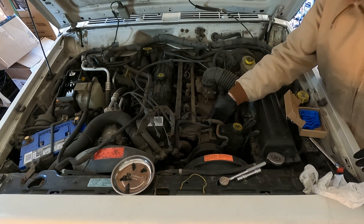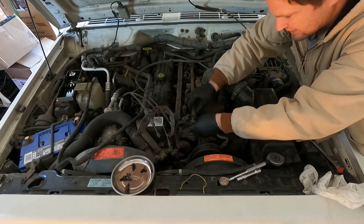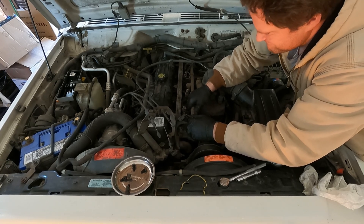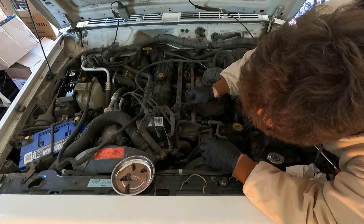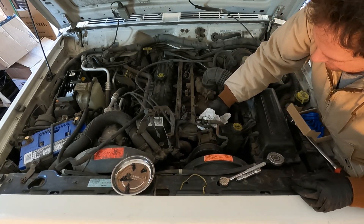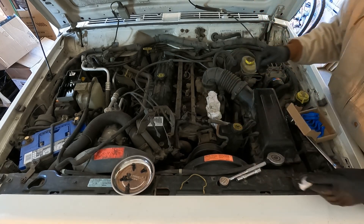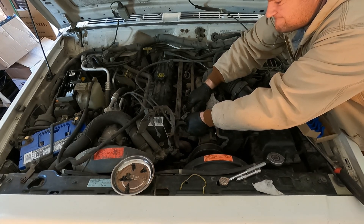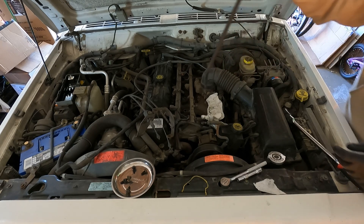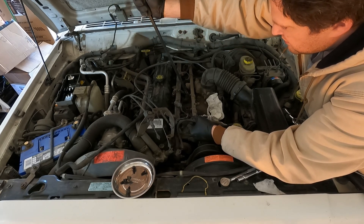To get the rest of the rail out, we just kind of wiggle it loose and pop it out. It should come out with all the injectors on it. It's not wanting to. So I'm going to clean up any gas that spills so it doesn't have problems catching on fire later. Not too much was leaking out of there. So this has been pretty stubborn, so I'm just going to grab a pry bar here and gently pry all of these out.